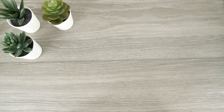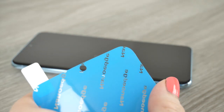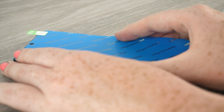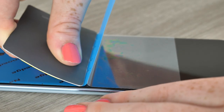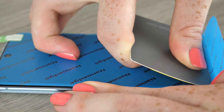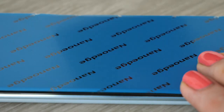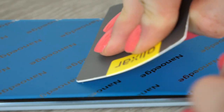With this done we can now turn our attention to applying the film. Pull back tab labelled 1. This will expose only a small fraction of the adhesive. Carefully match up the area to the top of your handset. Use the camera to help you align the film to the screen. Use the application card and smoothly run it along your phone whilst holding the screen protector vertical, allowing the film to seamlessly detach from the plastic and attach to your phone's display. When it is completely attached use the application card to firmly go over the film to make sure it is fitted securely.